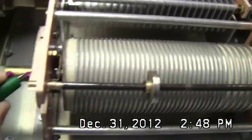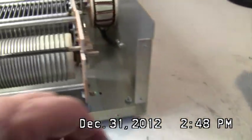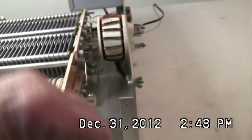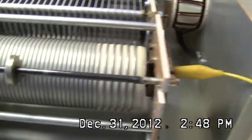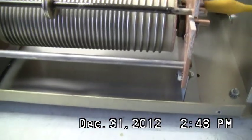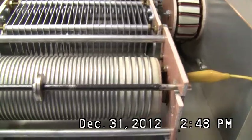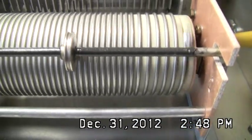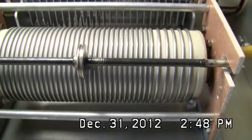Going back over to where the spring is, I clipped my meter there and there, turned the meter back on, put it back on tone — and the tone was steady. I cranked it and had no more erratic readings — nothing erratic anymore, everything was good. That's great — I'm not going to have any more rotor problems for at least another year or more.